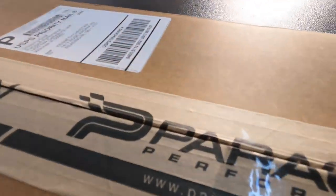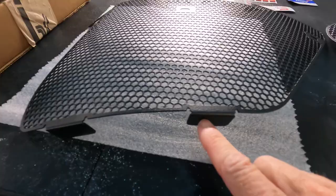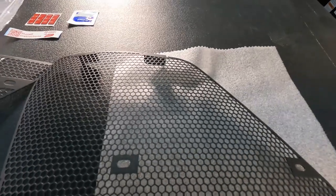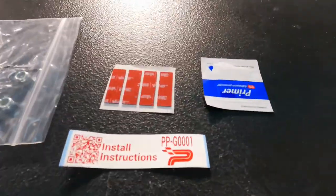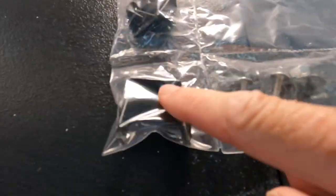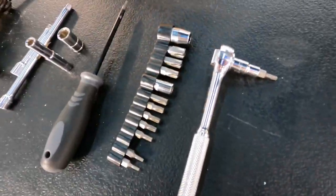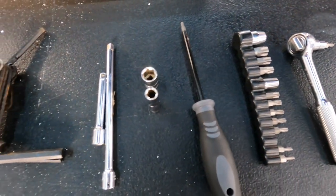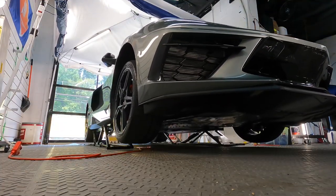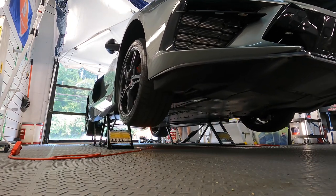There are a few different versions or kits to pick from. Paragon would be our choice. Some of the kits use zip ties, others just double-sided tape. This one uses five contact or connection points that combine a little bit of double-sided tape with actual bolts and screws. The hardware, including brackets and the alcohol to clean off the surface area, comes included. Additional tools you will need include a T15, 7mm socket, 11mm socket, an extension ratchet, a flathead screwdriver, and a 3 and 4mm Allen key.